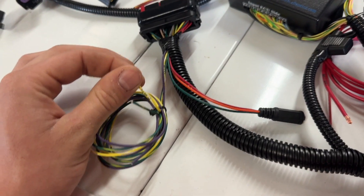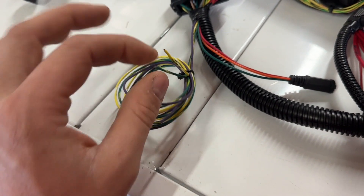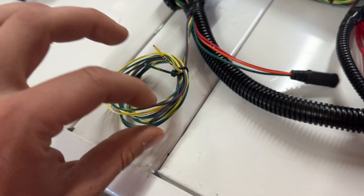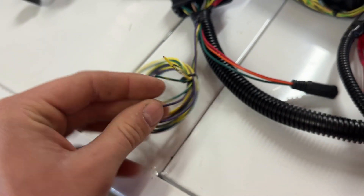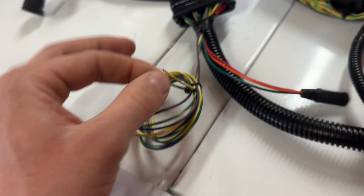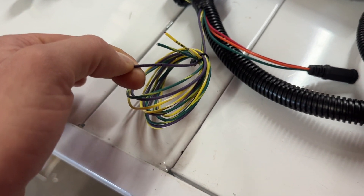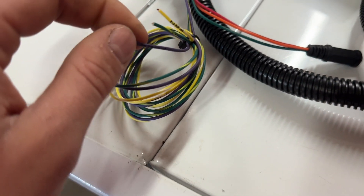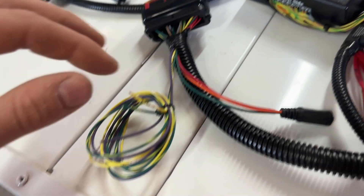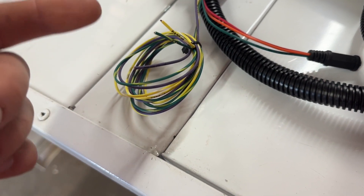I'm not sure why it's labeled as the fan wire, because this isn't a continuous 12 volts to kick a fan on — this would be a varying voltage to control your idle. So it's odd that this is out; it may just be a mix-up. Your green and yellow wire is going to be your tach — that's an output. And then the purple one is going to be your fuel pump on pin 8. I won't be using that — I'm going to run a mechanical pump with a belt.